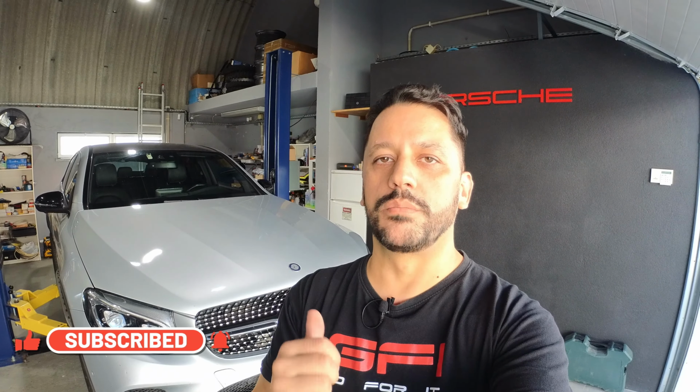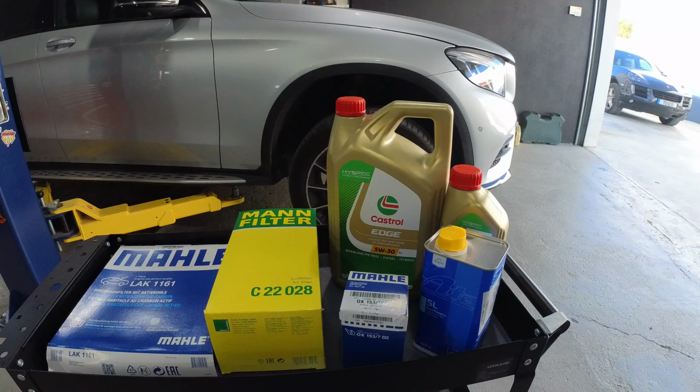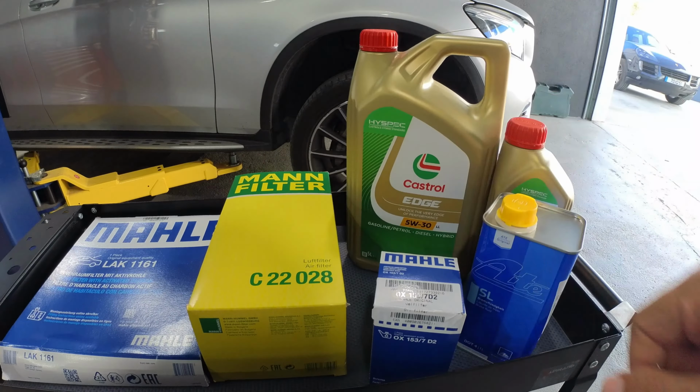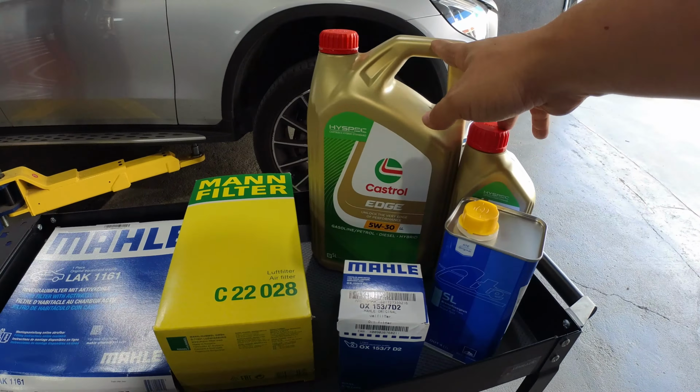Today I show you how to do the maintenance B1 on the Mercedes GLC 250 CDI from 2017. For this service we will use the recommended Castrol Edge 5W30. You will need 6 liters. I will use the oil filter from Mahle, the air filter from Mann-Filter. You have the references here and I can leave them in the description below.